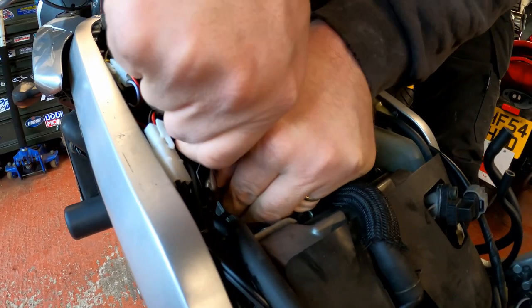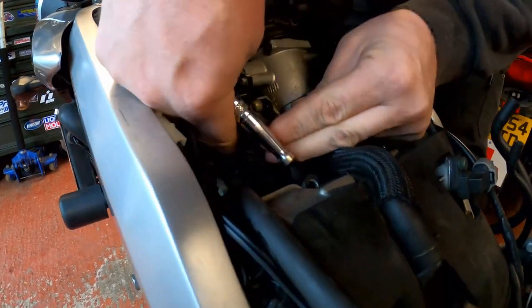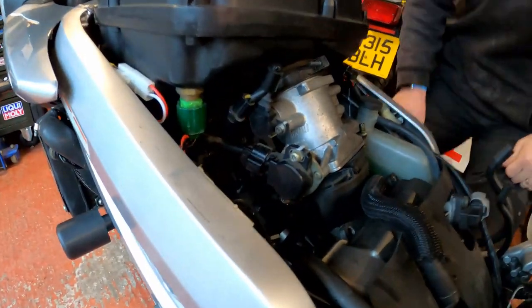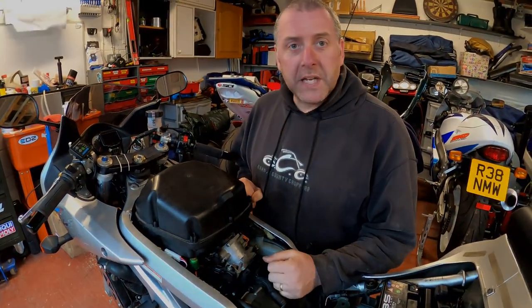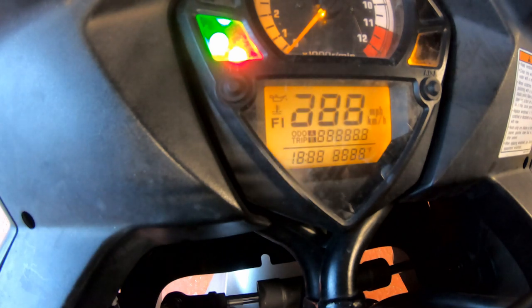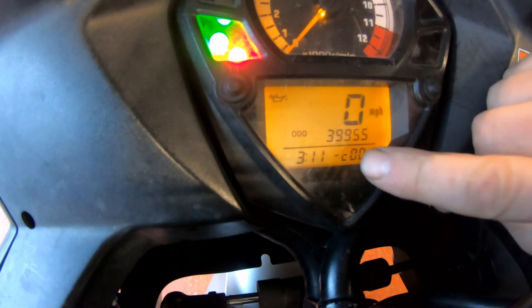Let me just crack the bottom one off. Now as you can see we can move the throttle position sensor around its axis — that's where we want to be. Next we're going to turn the ignition on and that will put the bike into dealer mode. The run/stop switch on the right switchgear is in the off position at the moment and we should get 'check' come up on the screen. Then we flick the red switch to the on position and we should get our code and the dash.